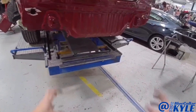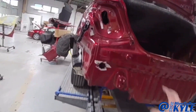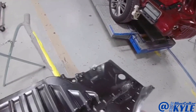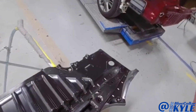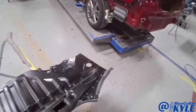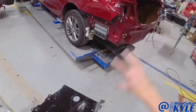Those pulls brought everything down just a few millimeters and now it's measuring out perfectly within spec. I'm going to go ahead and start cutting this rear body panel off, and when I get that out of the way I'll dive into the floor pan. Every time before I cut a rear body panel off, I look at the new panel to see how many layers of metal there are, because some panels are designed with double layers sandwiched together. This one is just single layered almost all the way around, except right here at this plate, so I know how many layers I need to cut through.